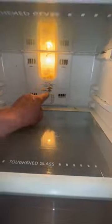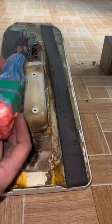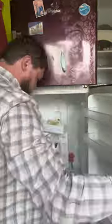I started by checking to see if the compressor was shorted to ground. After that tested just fine, I started to look at the electronics. Looks like the defrost timer went bad and someone replaced it with whatever they had on hand, and after troubleshooting a little further, it was stuck in defrost.